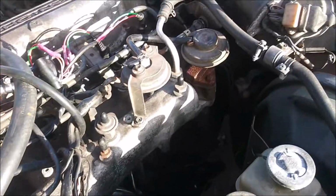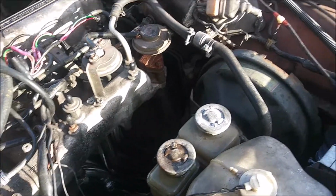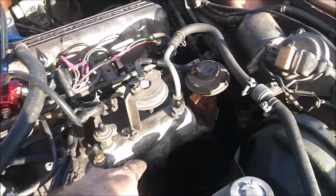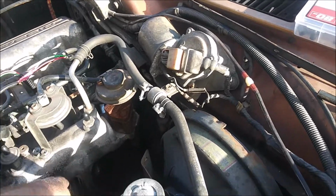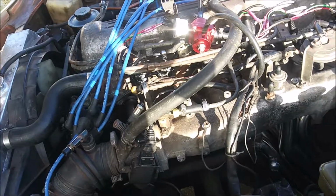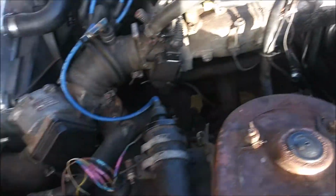I still got to get a muffler for this car, the rear section of the exhaust pipe. So pretty much I got to get the cat-back system part of it. I also got to get a plug for the headers, so I can plug off the EGR bung. I also got to tighten up the O2 bung as well.